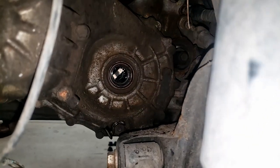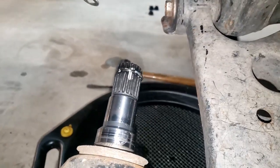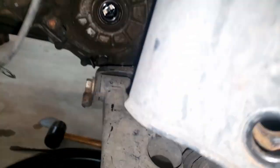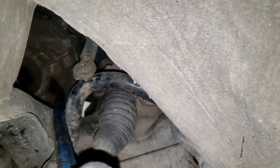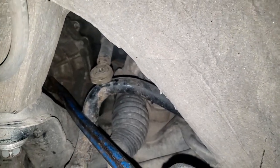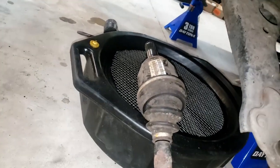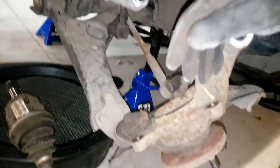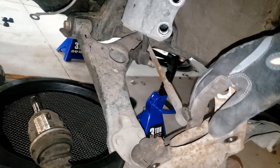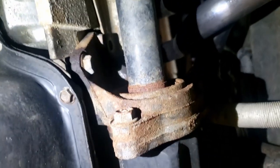Got the axle out. I found that using a crowbar and going in through the sway bar link, into behind where the axle housing is on the end of it, and then smacking it that way as I yanked out on the axle — that's what worked for me. I'm gonna put these bolts back in, rehang the caliper, put this stuff all back the way I found it, and then move on to the next thing.